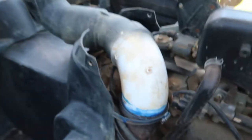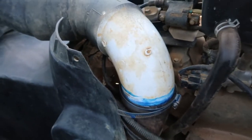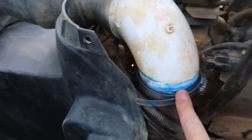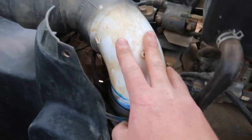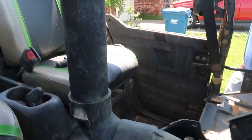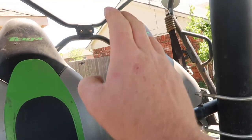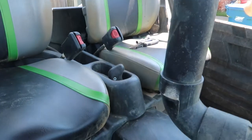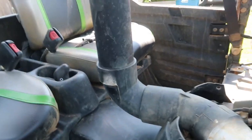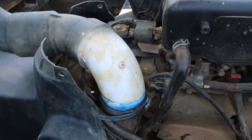Now we move back here to the belt exhaust. This is all two-inch pipe, by the way. The belt exhaust is three-inch, which the factory is three-inch. Again, you see the PVC glue connecting to the factory rubber connector here. This is a street 90 and then it just kind of goes up and makes its way up the back. This is the original design — the new design actually takes it up, comes over your rear cup holders, back up the back and over, hooking over the very rear. It really quietens down the cab noise, the whistle and whine you get from the belt.